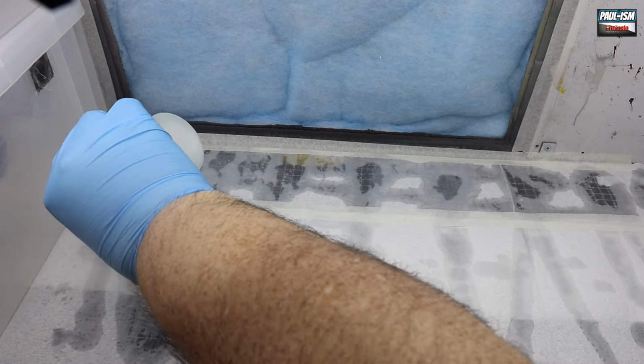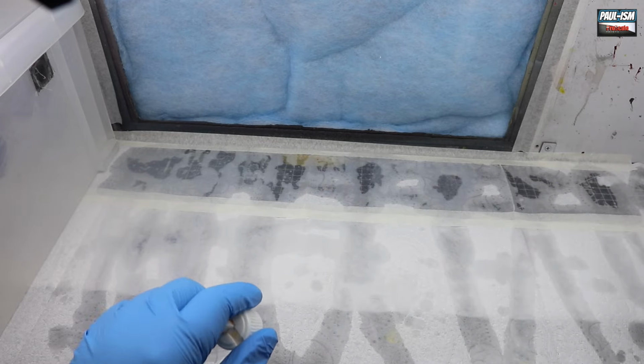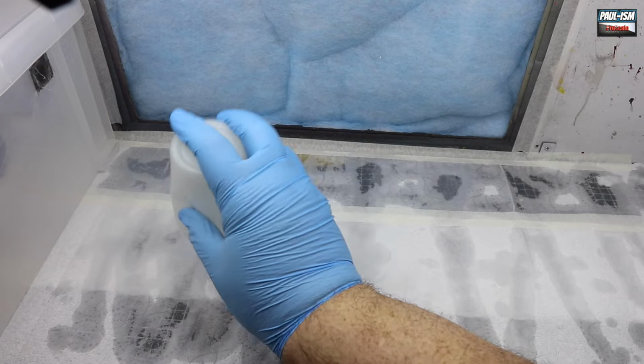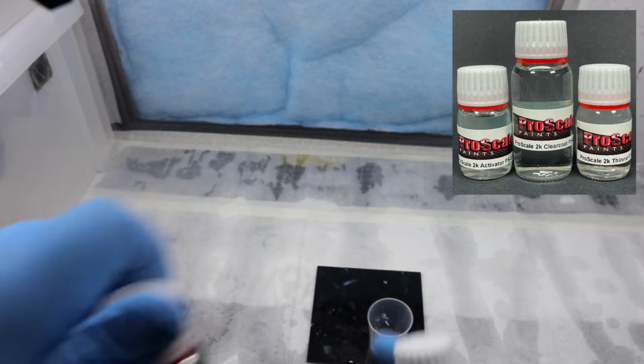And there we go. This is the next day. We're in the spray booth. We've got some water and we're wetting down all the booth. I've got a fresh filter in, fresh paper down. I've got my plastic storage tub to the left. My AS300 booth is on, extracting everything away. I'm double gloved, my left arm is covered, I've got my full face respirator on, and I'm in the room on my own.